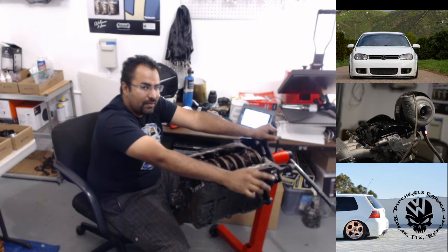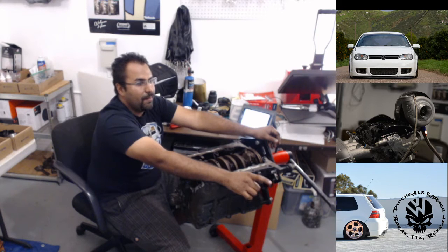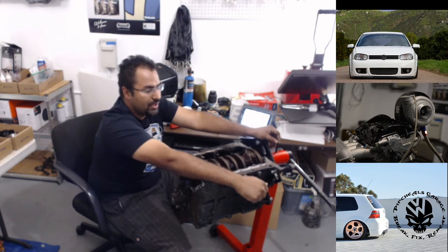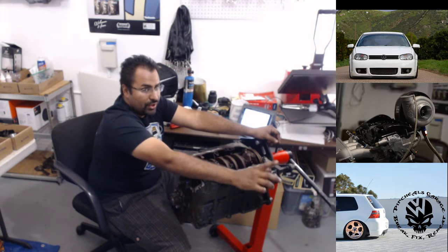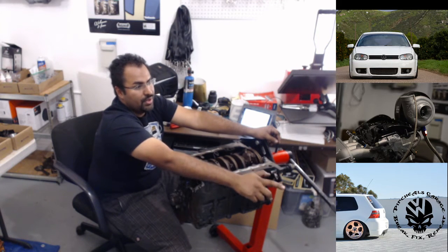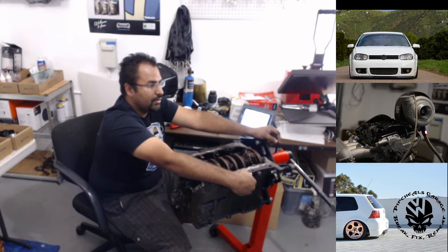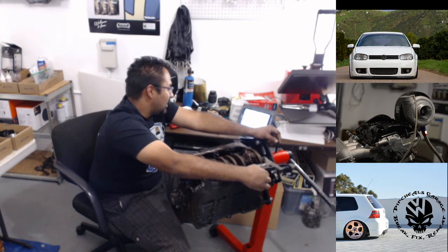And if you had it set up for recirculation and it was still smoky, then you might have oil going through the turbo and burning through the turbo and coming back out of the system when you were using that setup. Because I've never seen recirculating an oil catch can smoke. It's very uncommon. If it is doing it, there's a problem somewhere. I know you did a compression test, but if you took it out and there's no more smoke, more than likely the catch can.